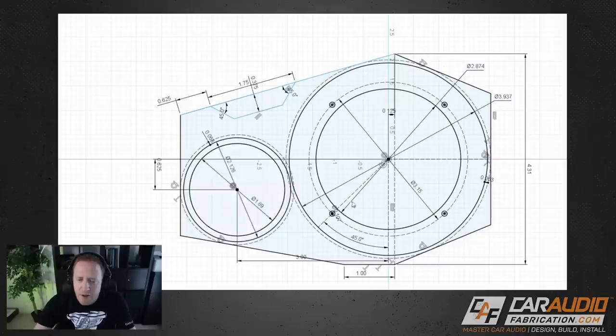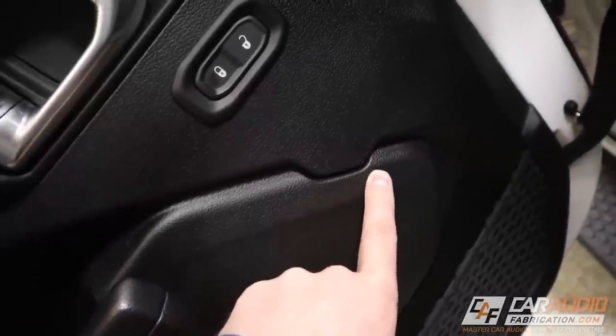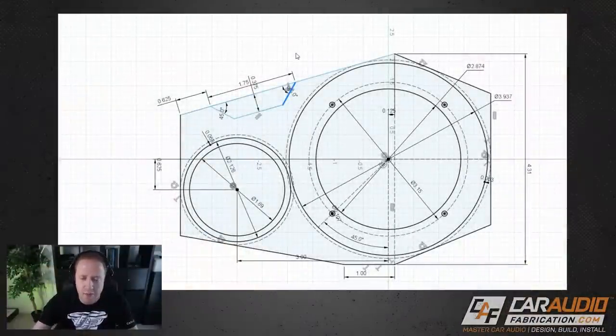Here's what I've created on the computer. The mid-range will be here and the tweeter here, and you can see some of those values from our initial dimensions. We've got the bolt circle value defining the center point of the through holes for our tapped locations, plus the inner and outer diameter of each speaker. I've also added dashed clearance circles about a sixteenth of an inch away from the outside of each speaker, because I don't want to get too close — especially once I wrap everything with vinyl and other materials. I've also added a tabbed area to give it a cool look that matches part of the door panel, carrying the design aesthetic throughout the vehicle.